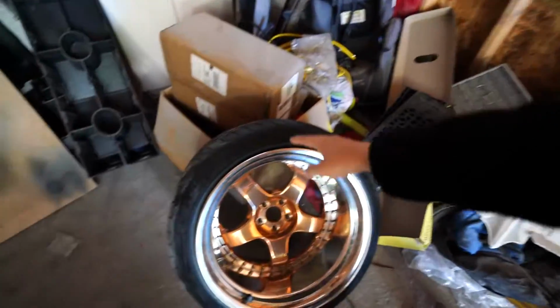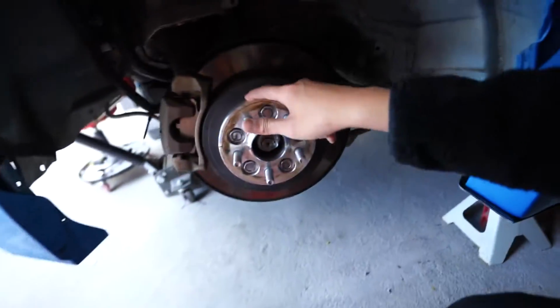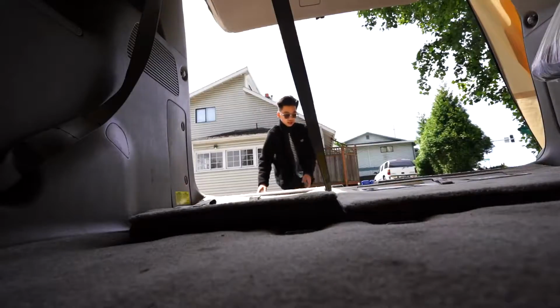So these are my rear wheels. They are 285/35s on a 12.5. And on this car, it's a bit too meaty once I put on the spacers, and the tires don't necessarily tuck under that right there. So I'm going to be swapping out the tires with 275/35. So hopefully going down one tire size will be just enough for me to tuck it and sit lip to fender. So without further ado, let's go ahead and load up my back wheels and the new tires.